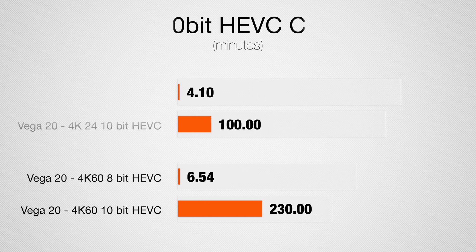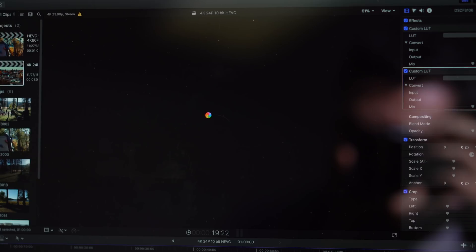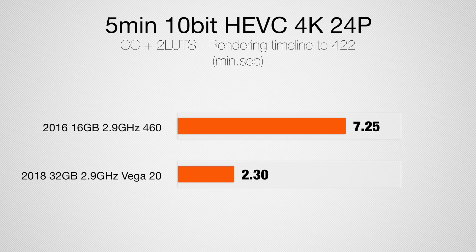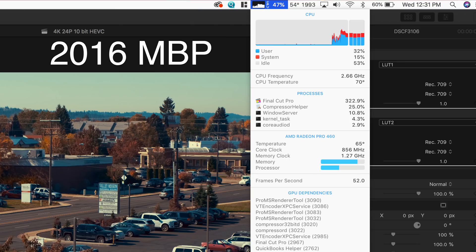That is crazy — we still have a very hard time for anybody wanting to upload 4K HDR footage. I want to point out that I wasn't even able to test this on my older MacBook Pro; I spent hours trying to get it to work, compressor just kept crashing. I reinstalled Final Cut and Compressor, tested it both on High Sierra and Mojave, and it would not handle that footage. One thing I was able to test is rendering the timeline — here the new Vega 20 model was almost 3 times as fast. The CPU and graphics cards were almost maxed out and it was flying through, where the previous one was just not very efficient. So if you're going to be transcoding 10-bit HEVC footage, this is one area where the new MacBook Pros are way better and the Vega 20 graphics will come in handy.